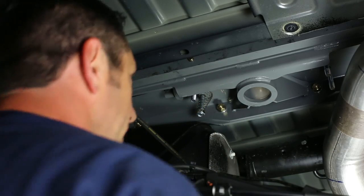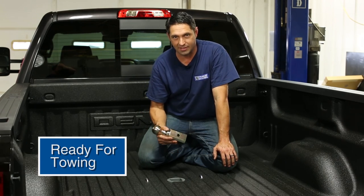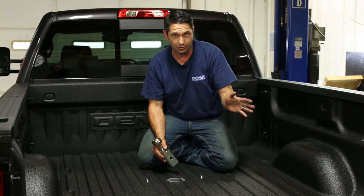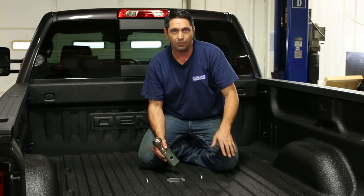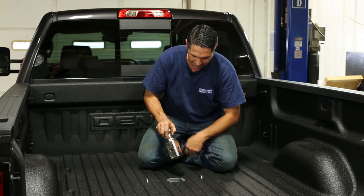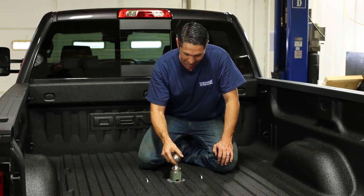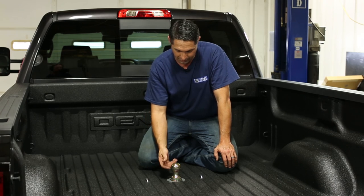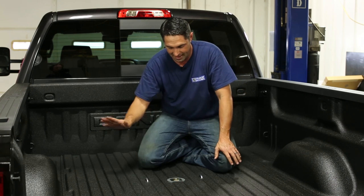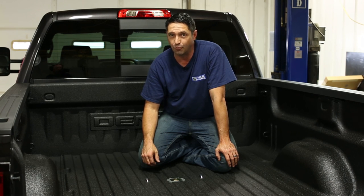Repeat that for the other three u-bolts. After finishing the safety chains, the last step is to install the gooseneck ball. While you were under the truck, that was a good time to put the exhaust back into place, put the spare tire heat shield back, remount the spare, and reinstall the fender well liners. Apply a nice light coat of white lithium grease on the rounded corners of the ball — try not to get any on the flat spots; keep those dry. Insert the ball when you're ready to tow a trailer, engage the latch pin, and you're ready to go. When you don't want to tow, disengage the latch pin, turn the ball over into its stowed position for a nice flat surface, re-engage the latch pin, and in true B&W fashion: a hitch when you need it, a level bed when you don't.